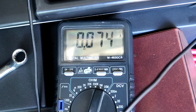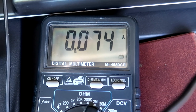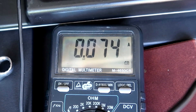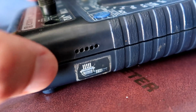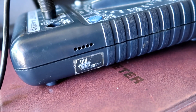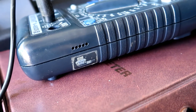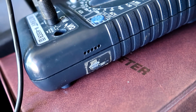One hour after plugging in, the 12-volt battery doesn't take more than 74 milliamps, so it looks like the battery is full. I've also just noticed that this device has a connector for an external computer — there are five pins. I need to find this cable because I could actually log all the data on a laptop and see what's going on while the car is parked.